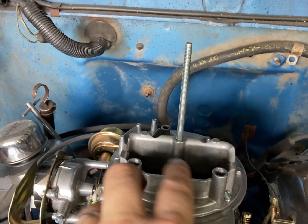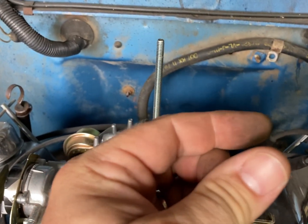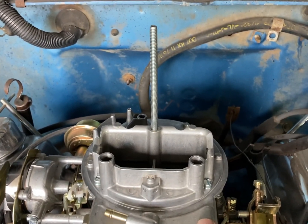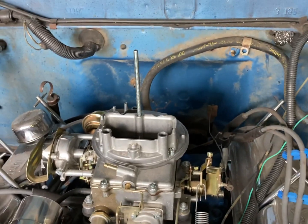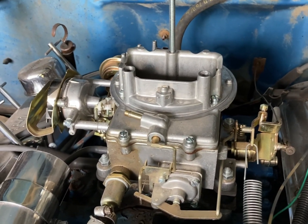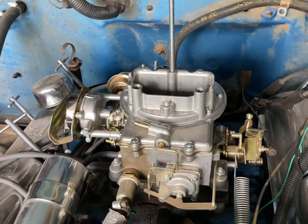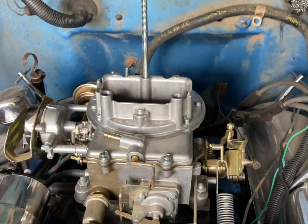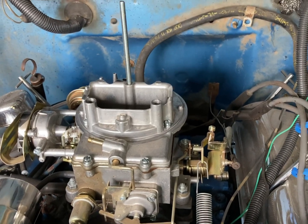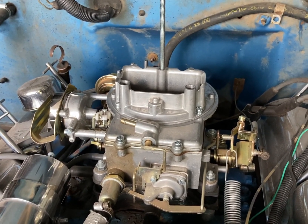Bend them up toward the direction of your carb hat, make sure they're joined together and attached with a hose clamp or some sort of attachment device. But this is pretty much it — everything in a nutshell on how to boost reference your carb. Again, this is for a two-barrel Autolite or Motorcraft two-barrel, and this is going to be my methodology on getting boost referenced. Just a disclaimer — this is how I'm doing it, so take all the necessary precautions and measures to make sure your setup is to your liking.